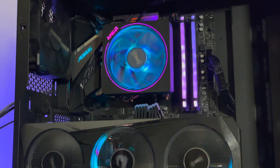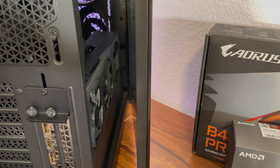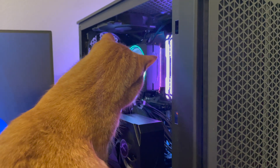One thing we learned today: do not vertically mount your GPU in the Corsair 4000D Airflow case. When vertically mounted, especially with RGB fans it does look great, but this particular 3060 Ti is a thick dual-slot card and didn't have enough clearance between the glass and the fans — it was essentially suffocating the GPU. You could see that in the high temps and FPS drops. The Ryzen 5 5500 is definitely worth it in 2023. Please like and subscribe, let me know your video ideas in the comments, and hope you have a great day.